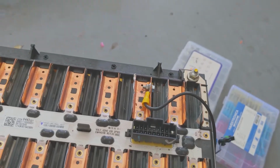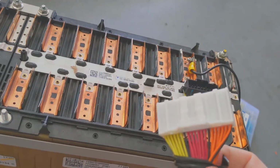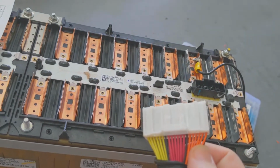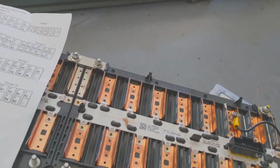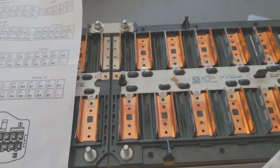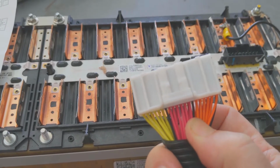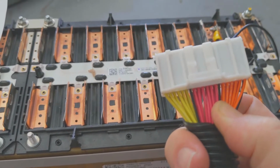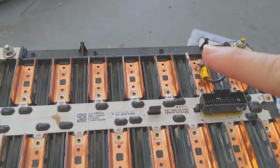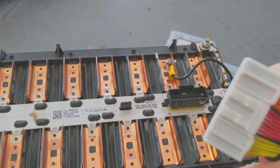But what that allows me to do on our wiring harness is have a lead. So the first group, I think, is going to be the orange. The orange would run from here all the way up to 12, and then it would allow me to have a lead for this next one in the red group, the black, the ground for the red group. I actually have a lead to tie it to. And even though minus 13 is exactly the same as 12, this way I have a single lead for it that gets tied into the loom correctly.